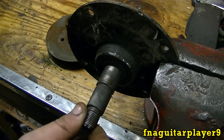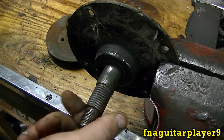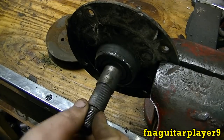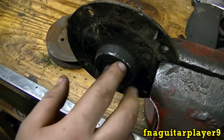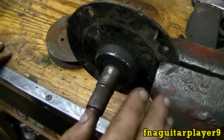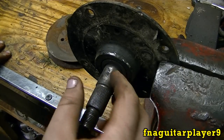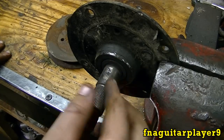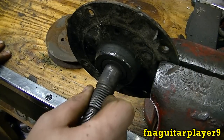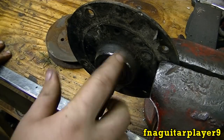Here's the first one we're going to look at. You can hear it — it sounds like a dry bearing. The shaft has a whole lot of play in it. That's how you know if you've got a bad bearing or bad shaft. Now if you're planning on just replacing the bearings, be sure to tear this apart completely first — not going to do that in this video — but that way you know if your shaft is still good, because you might go to all the trouble of ordering new bearings and it turns out your shaft's bad too. Then you'd have been better off just buying a whole new quill assembly. Most of the time you are. This one here has a lot of play in it too, so it's definitely bad.